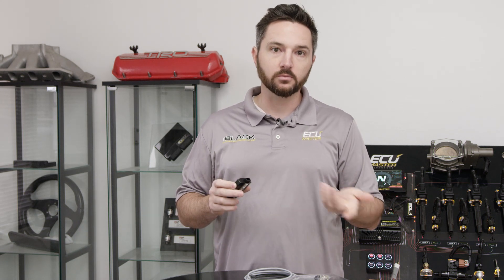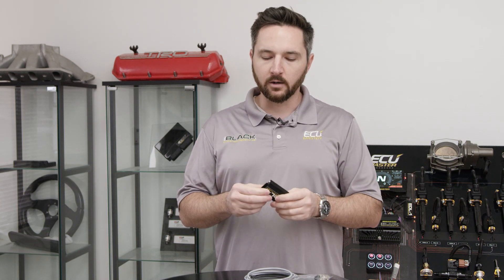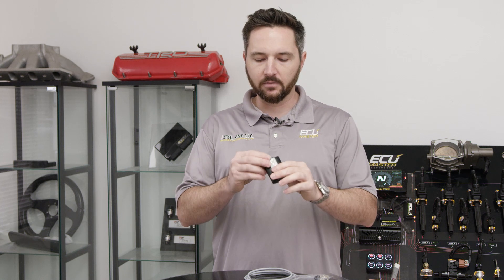For the wire connection, you just need power, ground, and the TXD output — the transmit output from the ECU — and that goes to the RxD, the receive terminal on this. The beautiful thing is it logs every single channel that the ECU sees, so you don't have to go into the ECU and format which parameters to transmit or at what rates. It just transmits every single logged parameter. So if you're diagnosing an intermittent problem on a car — maybe a wiring fault — it's nice because you don't have to know what you're looking for before you look for it. You get the data log and can do all the detective work after the fact.